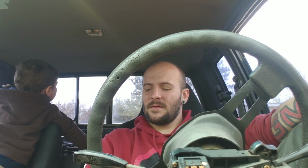And hopefully the trans holds up, because it's the same bolt pattern as an R154 trans, which is in the Toyota Supras, which, as you know, Supras are dyno queens. They put up huge powers with a small amount of build to a trans. But people are swapping the R154s for Colorado and Saturn Sky transes. I'm going to start with a Colorado trans because they are cheaper.